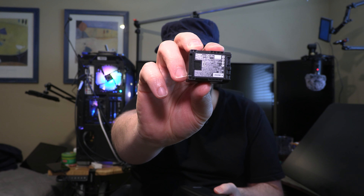Now I'll turn this on just to show. Right now it says there's 36 minutes of battery life, but then plugging in the power bank, it changes to DC in. So as long as the power bank has power, this camera will be powered. The test I did briefly: these will operate for about 11 hours just on the power bank. I ran it for an hour and only drained about 9% of the battery. So that gives me about 10 hours on the battery bank plus another hour and a half on the actual internal battery.